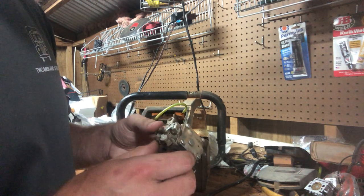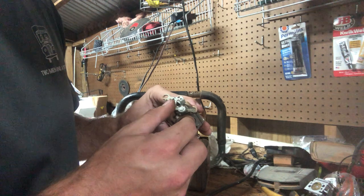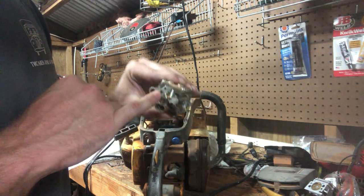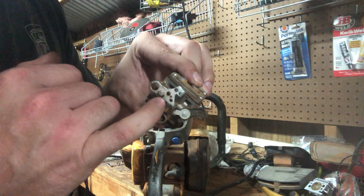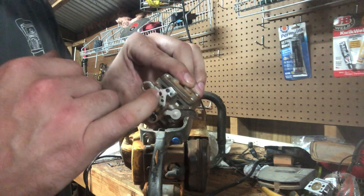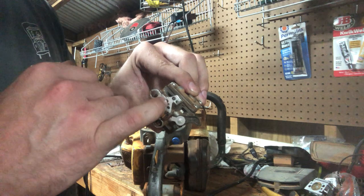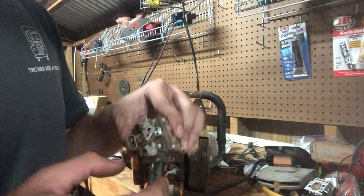So, to get this to work on a Farm Boss saw, your factory, double check on this. Yeah. You can see here, there's a couple different holes drilled. I tried different mounting options. Honestly, the one that's worked the best on Poulan chainsaws is the factory X-Torq throttle linkage hole. It does work, gets full throw, so that's pretty easy.